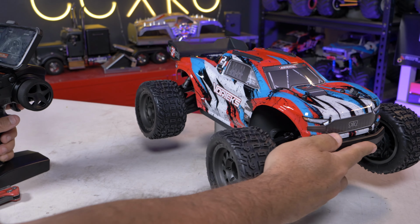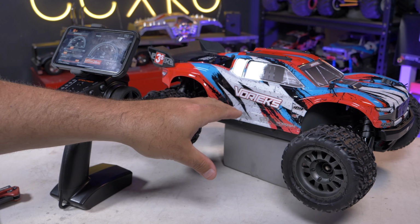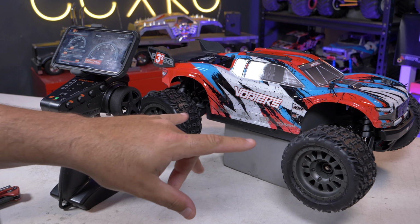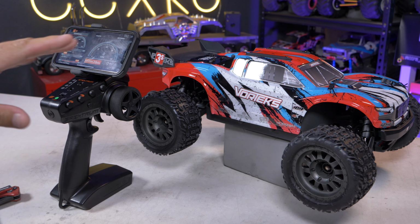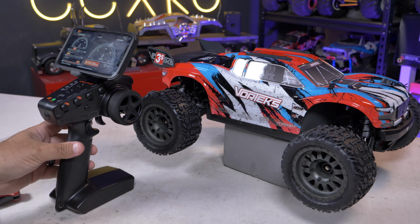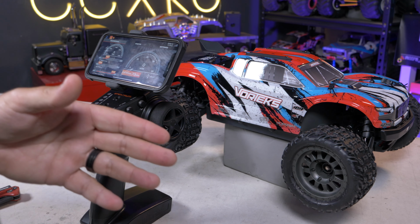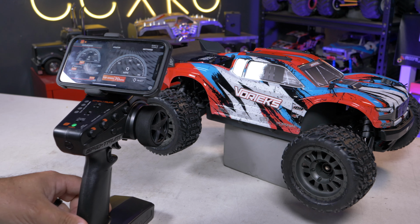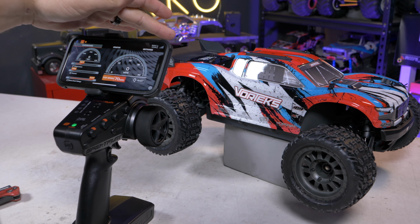So one of the things to note about this is that speed is being generated using RPMs, your rollout settings, all of that, and the motor pole count in order to basically figure out the speed. So the rollout would be the wheels, the size of all that, and how far it goes to roll a distance. And then it can use that data to calculate what speed you'd have been going. So the part that's deceiving is you could go full blast off of a start and it could spin tires and it might not give you an accurate reading. You might never get up to full speed after that. But I've checked it when I'm doing speed runs and where I'm slowly getting up to speed, and it's pretty accurate within 1 mile or 2 miles per hour of the actual GPS speedometer that I had on there.